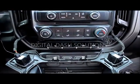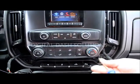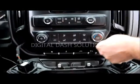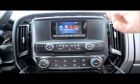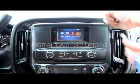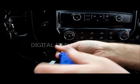These wires can just be moved out of the way and set this down. We got 4 screws holding the LCD in. Remove the 4 screws. You can leave the battery connected the whole time during the process and up to half an hour after the process. Do not disconnect the battery at any time while installing it, HMI or the LCD screen.